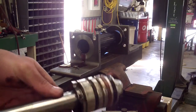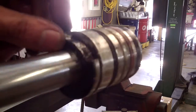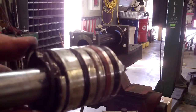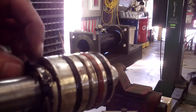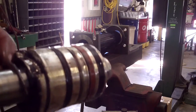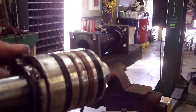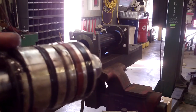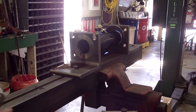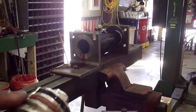This end cap has a groove in it and the snap ring was in that groove. So it's not a matter of just taking the snap ring out and then pulling this out, because you've got to squeeze this snap ring in and pull this out at the same time. My roller tamer came in handy for that. It also comes in handy when I rebuild these pistons and I'll make another video of that.